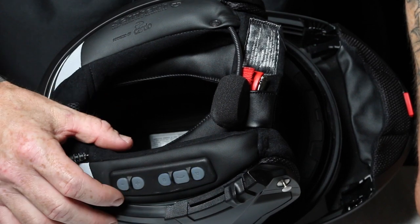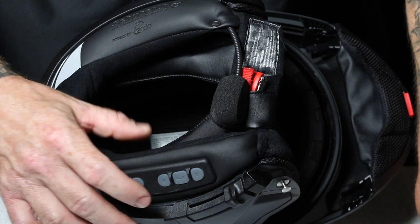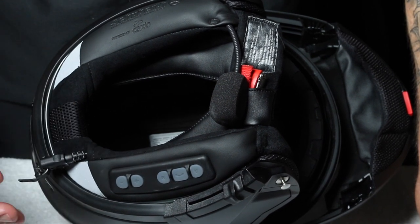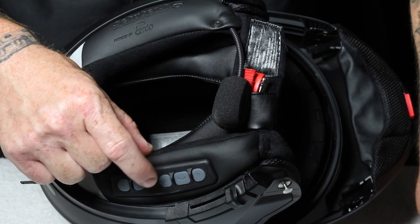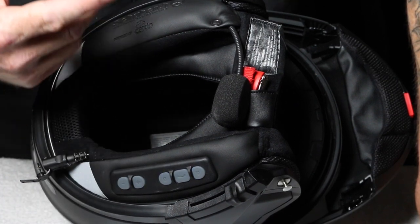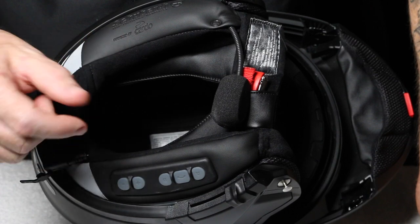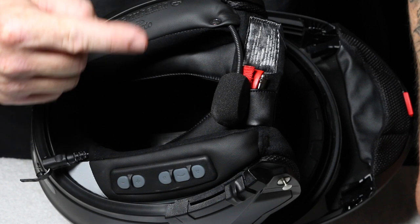You heard the beep, now you hear the music. I'm going to push the B till I get static. I'm turning the volume down. The reason I did that is, again, I don't want YouTube to pick up on copyright infringement, but all I did with the B, that's your presets. I was pushing the B, and each one goes through the 6 presets you have, so you can have 6 presets. Each time you turn it on, hold it for 3 seconds, the radio turns on; to turn it off, hold it another 3 seconds. And once it's on, you can just push B. It advances one at a time through those 6 presets.